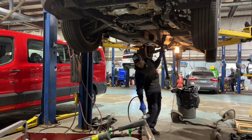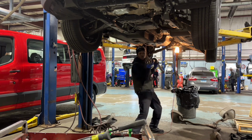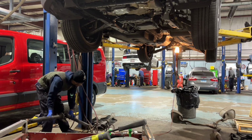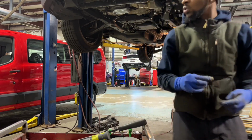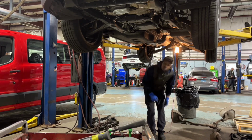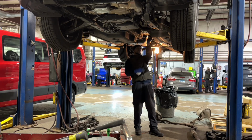Now I'm gonna have to drop that bolt and pick it up after. Okay, this is coming down. It's heavy. There you go. Pulls right out. I'm gonna just put the drive shaft right on this side. It's probably gonna drip a little fluid, so make sure you get some piggy mats or something on the floor. You see how it's dripping fluid. So move these bolts right back in so I don't lose them. That's what I like to do. Keep my bolts together, man.